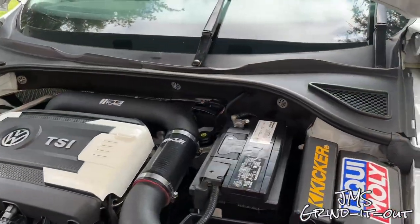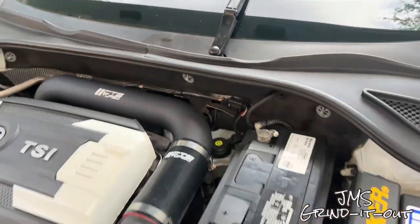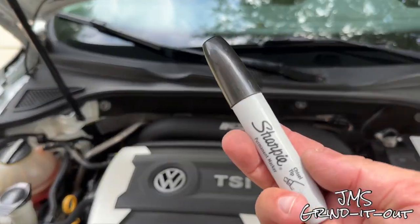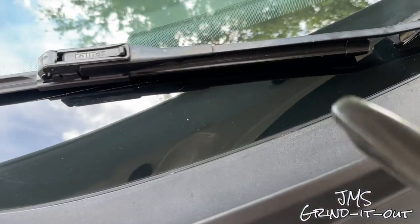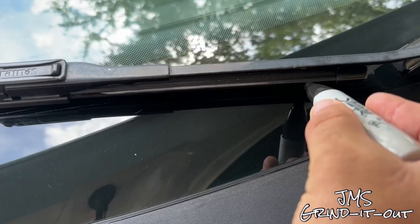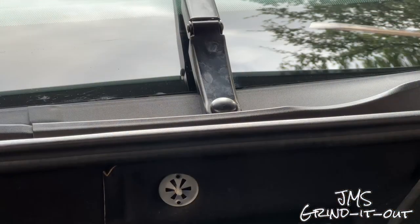Open up the hood of the car. It doesn't matter what position your windshield wipers are in — I put them in service mode and then laid them back down. It's good to mark these with a marker; it comes off, no big deal since it's on glass. Mark them so that when you put them back, you know exactly where they go and how they're supposed to go.